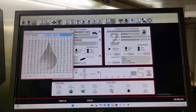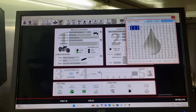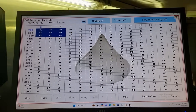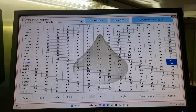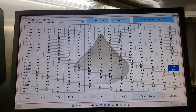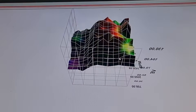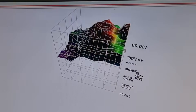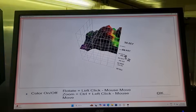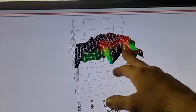Let's look at some VEs. Right away I can see the idle has been set — let me bring this bigger so you guys can see. Not too bad. I can see it's added some fuel through here on the roll-on. Looks like there's not much going on there as the efficiency decreases and then it comes back onto the cam. We can also look at this as a graph. I can see already it needs some improvement — it's quite choppy and changey.